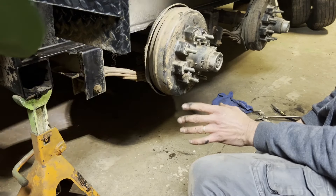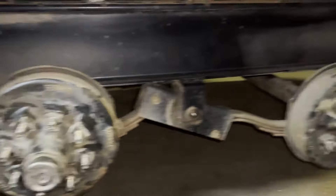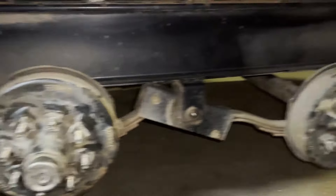The word I was looking for is the brakes are glazed over — they get glazed and they're not as aggressive. That's why I like to have them just very close and adjusted up good. For you people that noticed, I put that cover on but didn't put the cotter pin back in to lock the nut — so I did take it back off and put the cotter pin back on, then the cover's back on again. Both sides are done on this side. I also greased my walking beam pin right there.